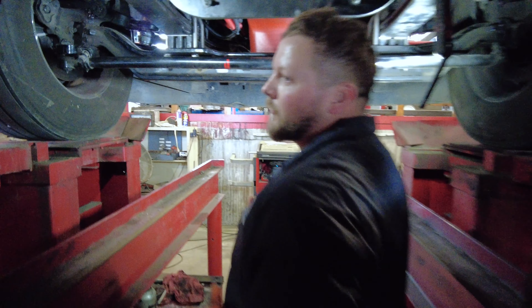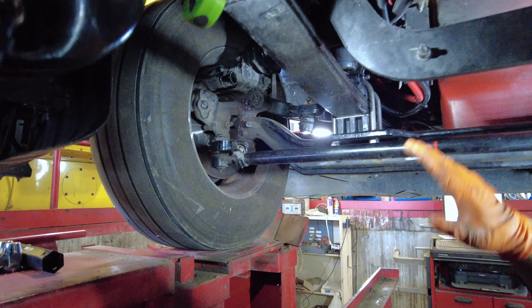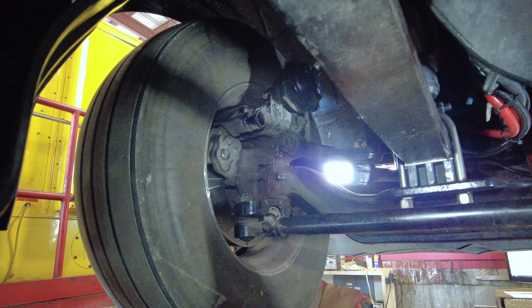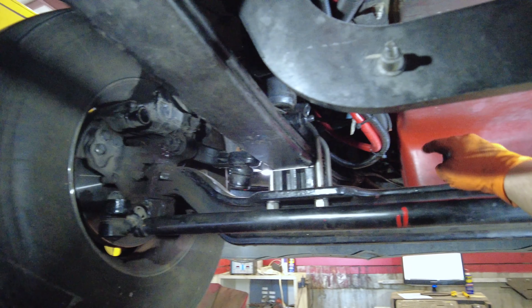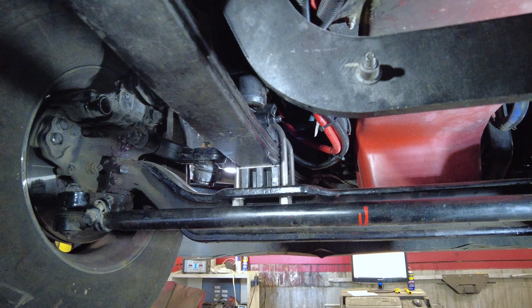So I was able to get up here. When we were compensating, there's no abnormal wear on the steer tires. The king pins are tight, wheel bearings are tight, tie rod ends are tight — no issues with the drag link. I think they put spring pin bushings in, since we've got new u-bolts and new spring pin bushings.